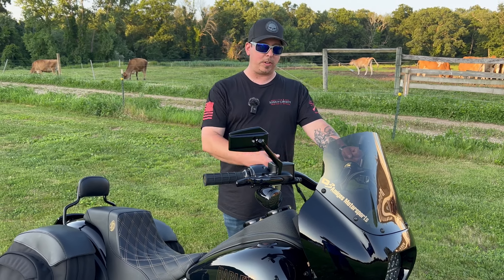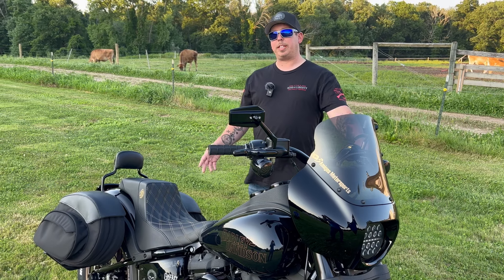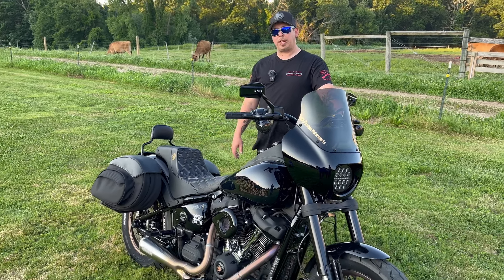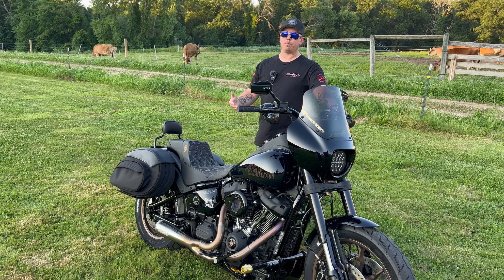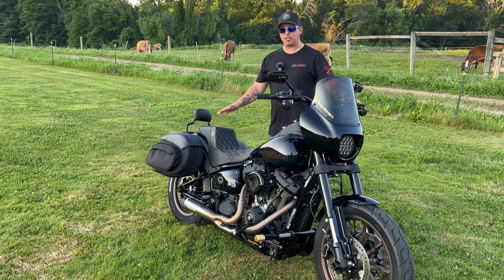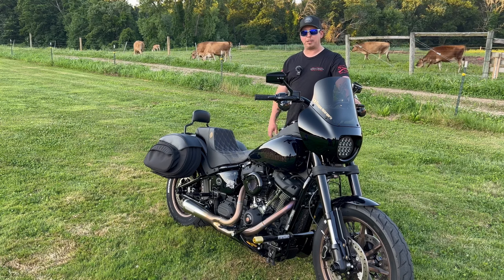For suspension upgrades — as mentioned, a previous video covered changing my rear suspension to match the front. I have Legend Axio cartridges in the front inverted forks. I was so impressed with the front performance that when I upgraded the rear, they didn't have a mono shock yet, so I went with Fox Racing. I was very impressed with the Fox, other than it being a little stiffer than I wanted even with adjusting compression, rebound, and preload, and I wanted a little more height. This year Legend finally released their mono shock for Softail, so I've upgraded to a 13-inch — about an inch taller than stock. About 500 miles on it now and the front and rear match perfectly.